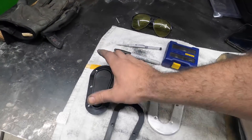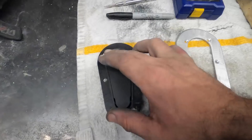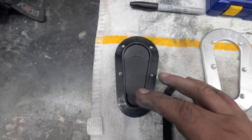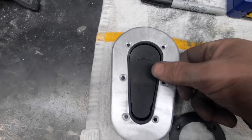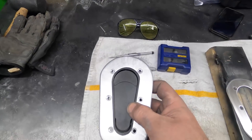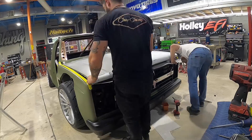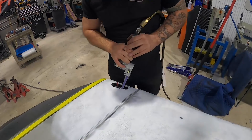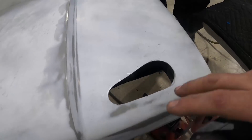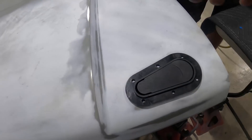We have these hood latches — this is going to go on top of our regular stock C10 hood. We're going to have hood pins come up, but we need a way to trim around them, so I took all my dimensions, made the inlet, scaled it open, made all my bolt holes, and came out with these pretty cool trim rings. They go right in the hole on top of the hood, we bolt them in, and we have ourselves a stylish ring. Now that we've had the trim plates in, I made them to sit flush underneath, and now we're going to do a little modification to the beauty plates so the wrap contours, then draw the holes, put it in, and pop the hood on.